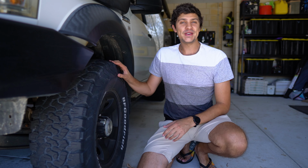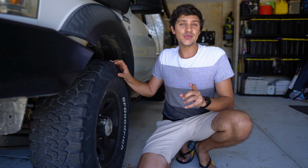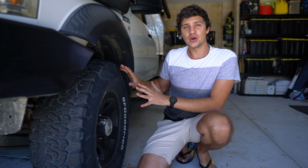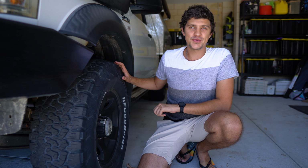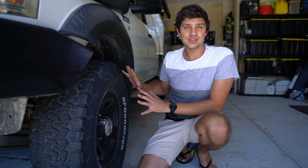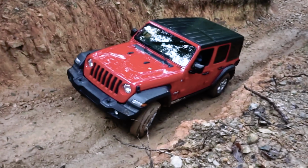Yep, the 5th and final thing I'd recommend you get early on would be a set of four-wheel drive tyres to suit your vehicle and the type of four-wheel driving you like to do. The tyres that four-wheel drives come on from factory usually have pretty weak sidewalls that are prone to off-road punctures, and while the tyres themselves might be fine for the sand, they do come unstuck when it comes to mud or rocky terrain.